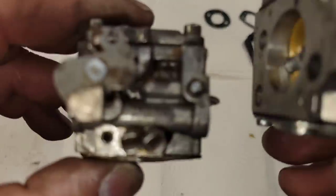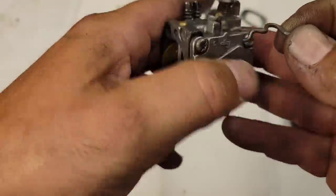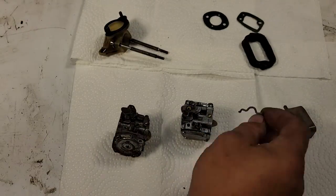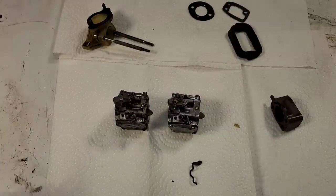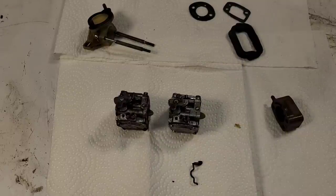You can see the difference. Big hole, little hole. There still is a little bit of play, but it doesn't move as bad, whereas on this one, it's clunk, clunk, clunk. And that throws off the mechanics. I tried bending the linkage a little bit and doing all kinds of different things to it, but it's just not going to work. I've tried several linkages. I can't leave it like that. And again, friends, this is part of my process when I build a saw. So I'm going to sit down on the other side and let's pull this apart and fix this.